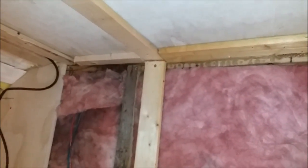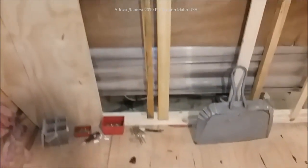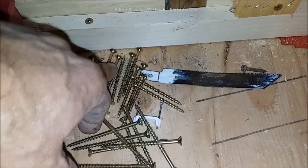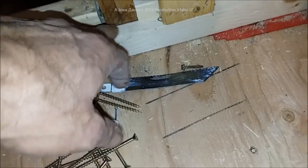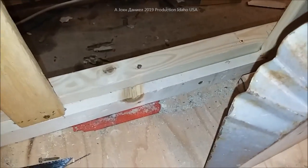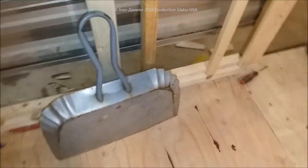And it is completely rigid now. This whole setup is rigid now. Down here on the bottom, we have a 1x2. We have a screw going down into the plywood floor, and in the second floor underneath it, it's a 3-inch screw, and we have it staple shot into the old stuff as well as off into the new. We doubled the 2x2s so that we have more material in the walls to attach to, and this is how it came out.